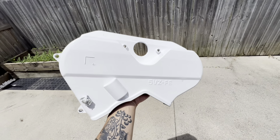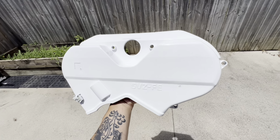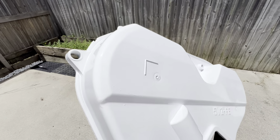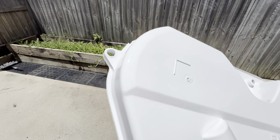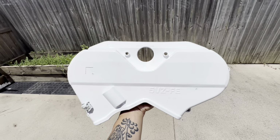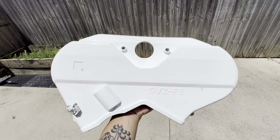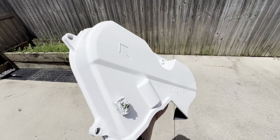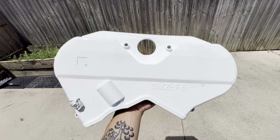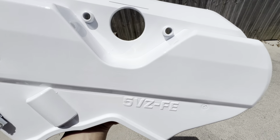Well, you guys have already seen it complete because it's at the beginning of the video, but that looks so good, white. And guys, as you can see, look how glossy. I'm not sure if you can see it in the video, but look how glossy it is. It's so glossy. And I'll give you guys a tip. When you're spraying with cans, and you want a real glossy finish like this, you spray one light coat and then just go heavy. Go as heavy as you can.